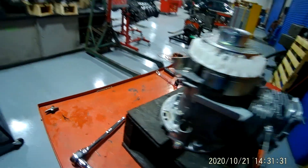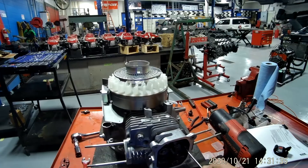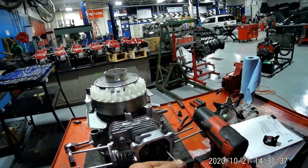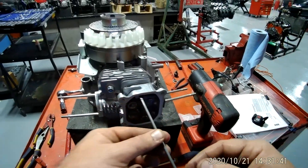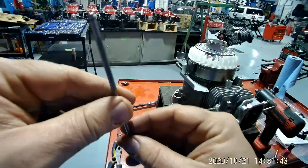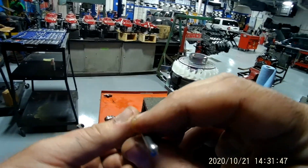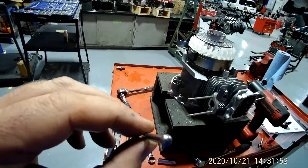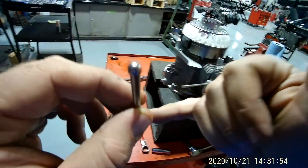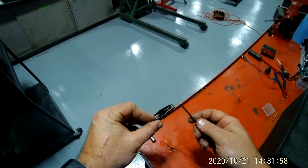I'm going to place that right here for right now and then take out my push rod. If you look, this push rod is just a metal bar. In automotive application you're going to have a little hole right here, and what that little hole is for is for oil to transfer through, so it can hit on the back of the rocker.